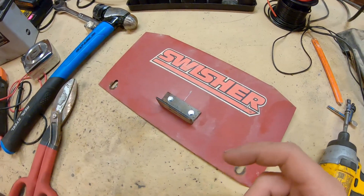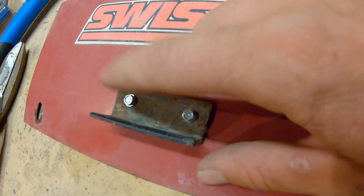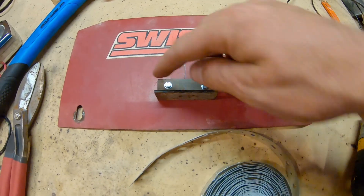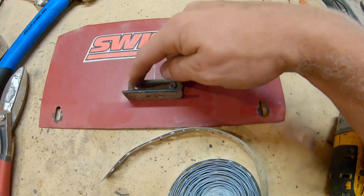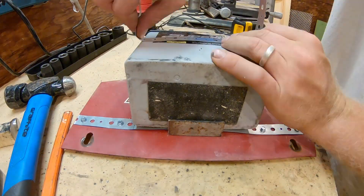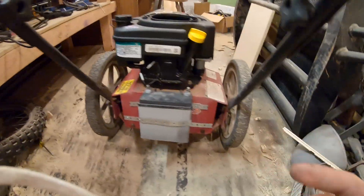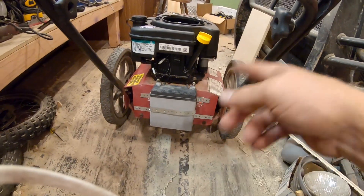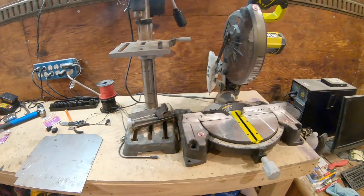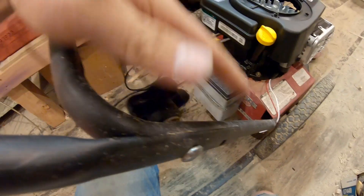Got to love wonderful weather — it's kind of shaking the whole shop. I'm a little concerned about these nubs sticking up wearing a hole in the side of the battery, so my plan is to put two layers of metal tape: one as a backing layer to shield the nubs, and one over the top. Just like that the weed eater now has a pretty substantial battery mounted to it. I'm going to turn this around to give myself a surface to work with, which will let me rest a piece of sheet metal here for the switches.